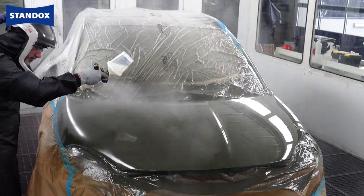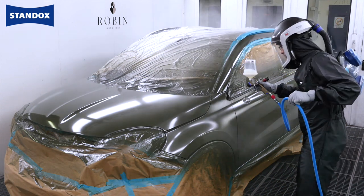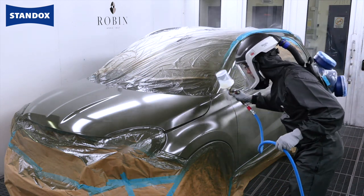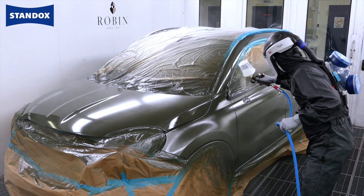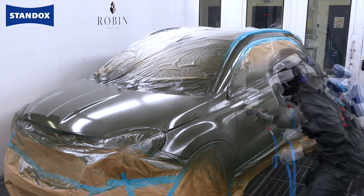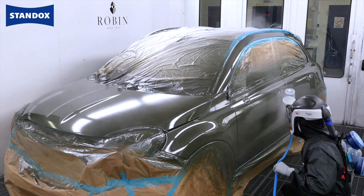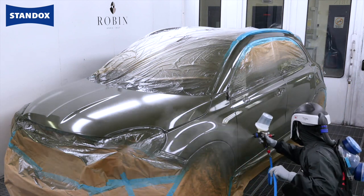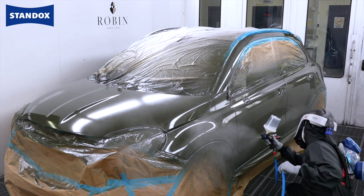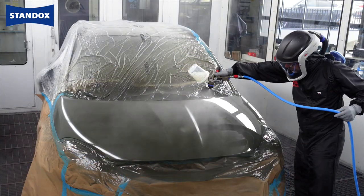Flash off time is 15 minutes. The second coat is a full coat and again is not difficult. The only point to stress is to stagger the overlaps to prevent high film builds in any one area — this is also good practice for any two coat clear. If both coats are not applied sufficiently wet and full then there is the possibility of patches being created. This is not a product that is applied in a light or mist coat followed by a full coat.